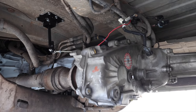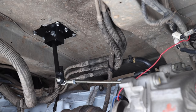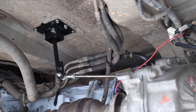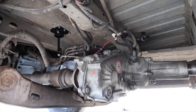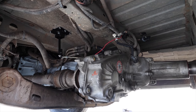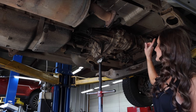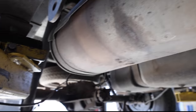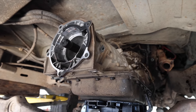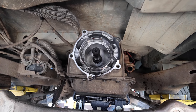This is the transfer case that I got off the used 4x4 Chevy S10. Above it, you can see the bottom of the shifter that connects to the transfer case so that I can manually shift the van. If you get the correct spline count on the transfer case, it's a direct swap. Here is the stock transfer case that I got help removing from the old transmission. The next step was to remove the transmission that needed to be rebuilt. If there's nothing wrong with your transmission though, you don't need to remove it in order to do this 4x4 conversion.